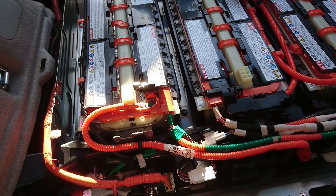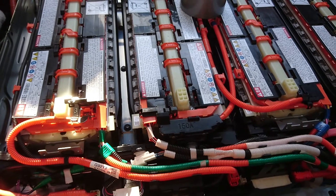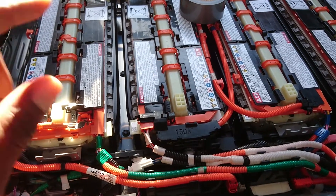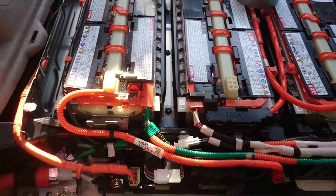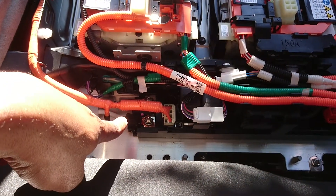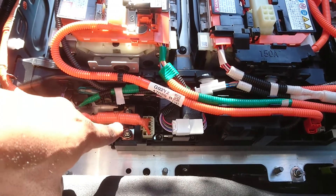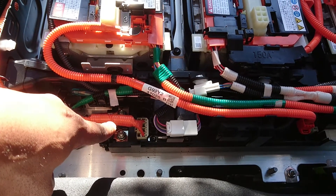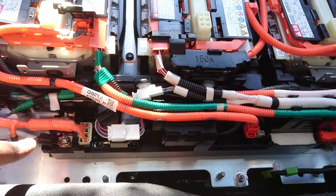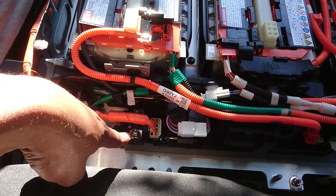What I'm trying to do to help this little battery is connect this one in parallel with the other one I just built. When you want to connect these two batteries in parallel, you need to connect them — but you don't want to connect them here. This is power going to the front of the car, to the motors. When you test voltage here the car is off so there's no voltage. These are the relays and contactors here — when you turn the car on, the power comes in here.